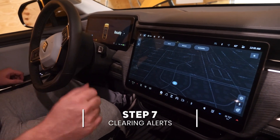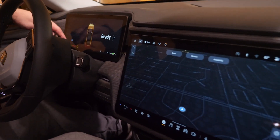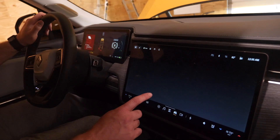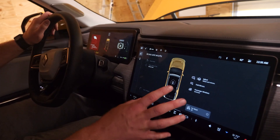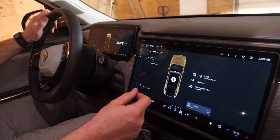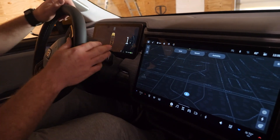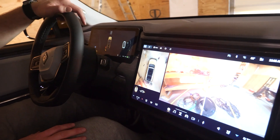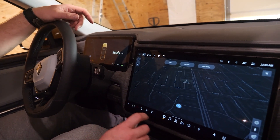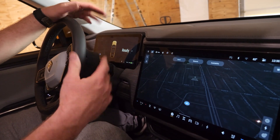When you get back in the car, close the doors, put your foot on the brake. Some alerts might start popping up — I just did this so they came up and now they went, but there are still active alerts down here. Go ahead and put it in drive. In this case I left the hood open so we're going to close that first. Things will need a little longer to switch between states since it's freshly booting. Now go into drive — it should allow you to do that with no problem. If anything sticks around after that first little drive, most drive alerts or inverter alerts should clear, and anything that remains should clear on your first actual drive.